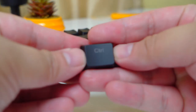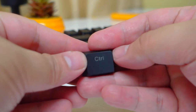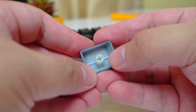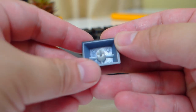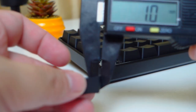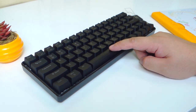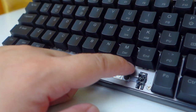In terms of the keycaps, although the font used is pretty good, the keycap itself is not so much. It is UV coated ABS plastic with laser etched fonts, but unfortunately it is not double shot and is super thin at around 1mm. In comparison, the keycap on the Geek GK61 is double shot with a thickness of around 1.4mm, which is way better. With regards to the stabilizers, they are quite decent without much annoying rattling sound and they come with some factory lube, which is always a good sign.